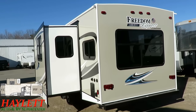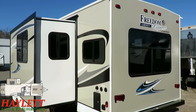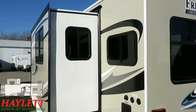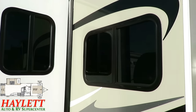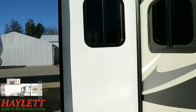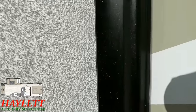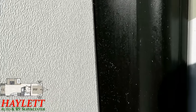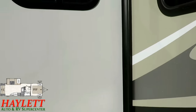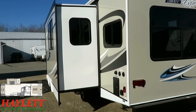All the windows open for ventilation, and they're very heavily tinted — that keeps the sun out, keeps the RV cooler, and gives you more privacy. Both the sofa-side window and the slide-side window open for airflow. This also benefits from a really cool seal-gripping leak-preventing slide system. See that really textured skin there? They have a T-shaped slide wiper seal so there's more surface area to grab the slide wall, meaning the wiper seal does its job going in or out.